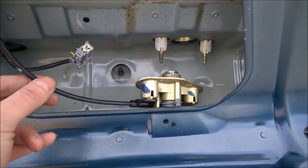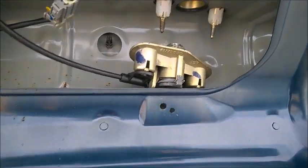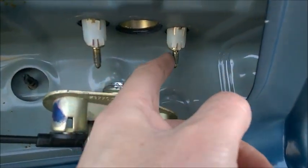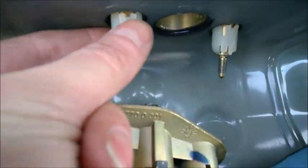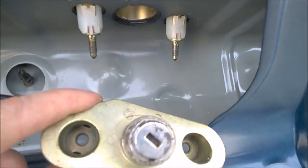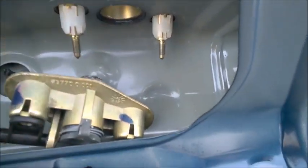That's why I'm doing this video — to detach the cable. Because if you want to keep your lock, you need to do the two lock bolts, which are 10 millimeters. Remember, these guys kind of have a clip, so when you try to pull down the lock it seems to be kind of stuck in there. So just wiggle it a bit.